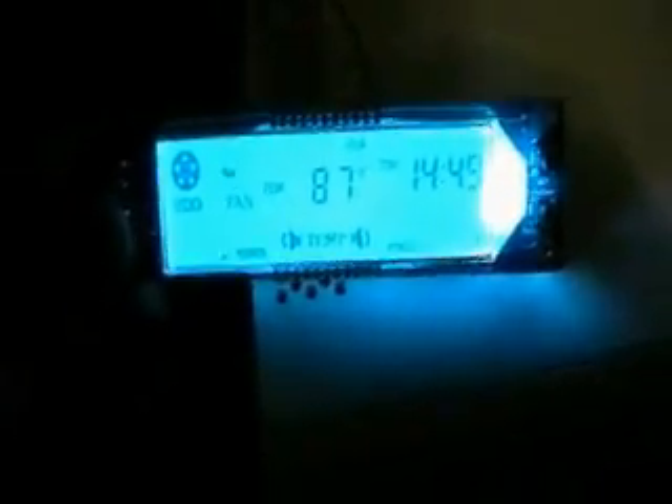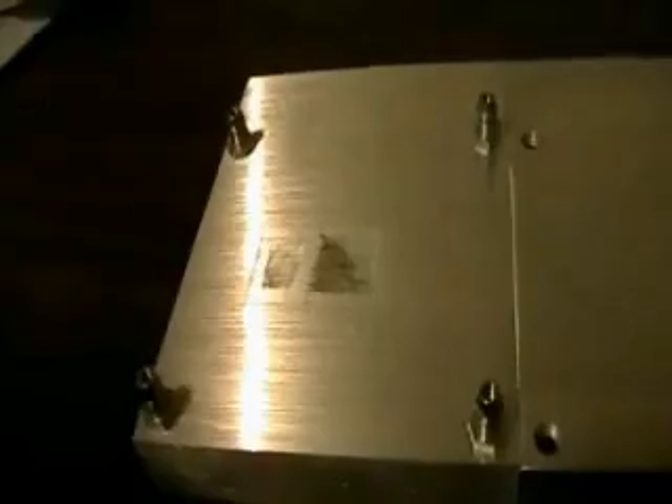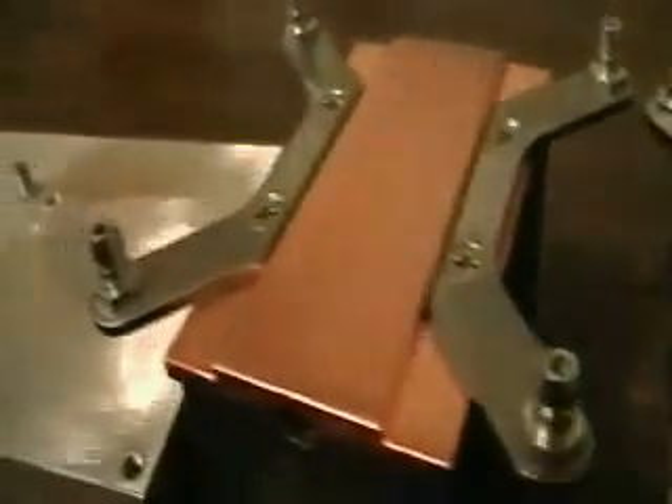And I'll be back after I do the heatsink upgrade. Here's a general idea of what the heatsink upgrade is. This is the stock heatsink that I took off, and there's the one that I applied — that's sanded down to 2000. And again with the CPU heatsink. I also put a piece of white cardboard over the GPU there.